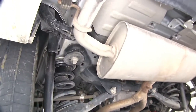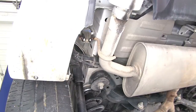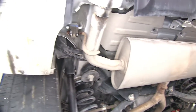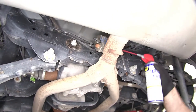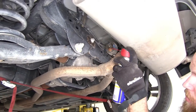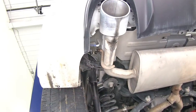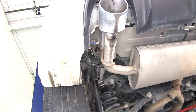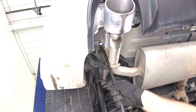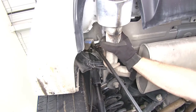In order to drop this exhaust, I'm going to take a little bit of spray lubricant and put it at the rubber hangers. There's one in the exact same spot on the other side. Once I've put it on that one as well, I can move up and spray some on the hanger right by the rear axle. Once you've got them lubricated, you can take a pry bar or a pair of channel lock pliers in order to get it off of there. Just pry and it should come right off.